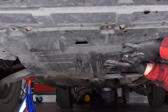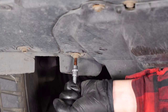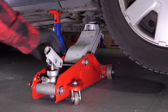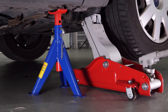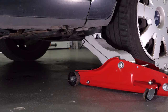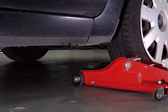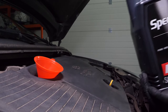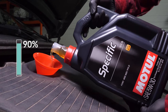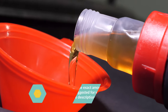Now you have to put the oil back into the motor. You have to be very careful and precise when doing this part of the job. First, lower your car back to the ground and check the oil level — this can only be done when the vehicle is flat. Now add the oil into the engine, beginning with 90% of the suggested amount. This will leave you a large enough margin to adjust the level appropriately. You can find the exact amount of oil suggested for your car in the description of the tutorial.